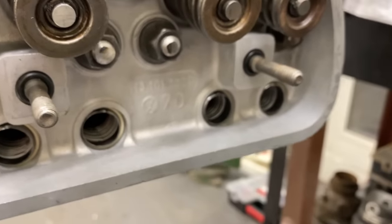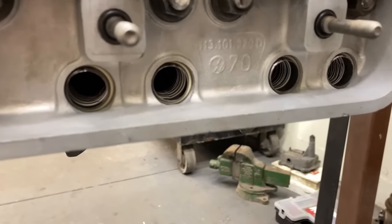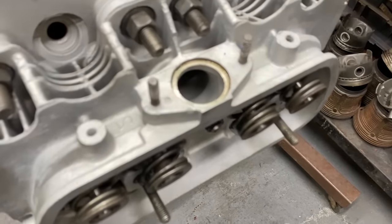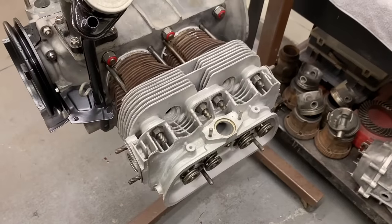So we got our push rods in there. We got our head all torqued on. Got our valve springs all on the correct way. Yep. Got a valve job. Somebody had asked about the crank. We did not turn the crank. We just measured it, and it was turned 10 thousandths but had standard bearings on it. So we corrected that.